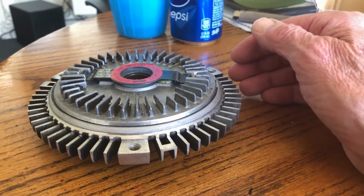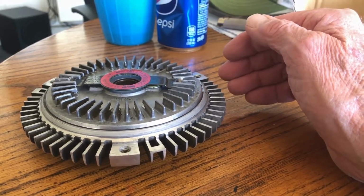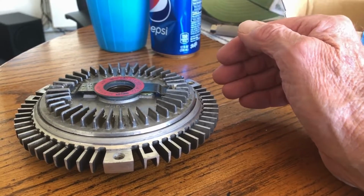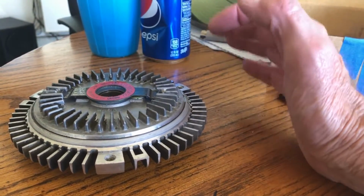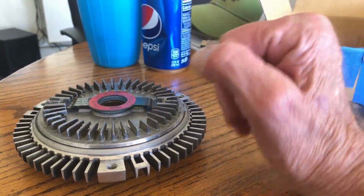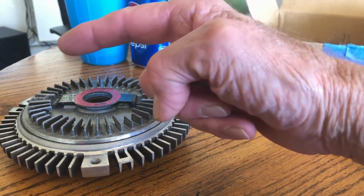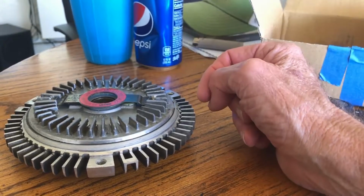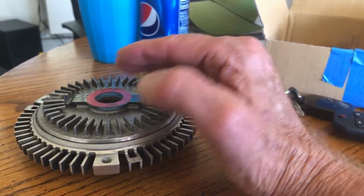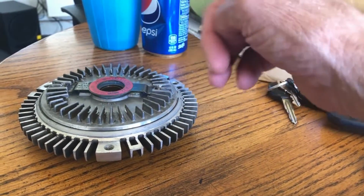You know, for mine, when we bought the car 10 years ago, a little older than that, bought it off eBay. My son and wife got it when I was at work and I came home, and then guess what? We got a 300E. And it came with a blown head gasket. It had oil mixed into the coolant. It was in the expansion tank. It was in the radiator. It looks like monkey poo. It's brown, and it traveled through the heater core, through the engine block. Now I've cleaned it all out, but I'm sure there are still little remnants of it stuck to the walls in the engine block, and that reduces the capacity of the cooling system, the coolant flowing through there.